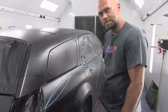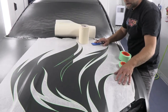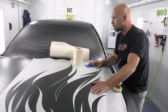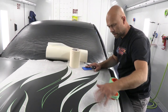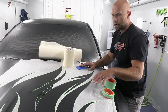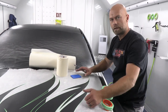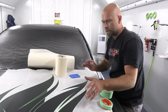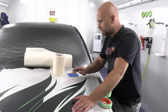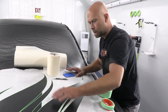Welcome back — we'll give you a quick clip on what I'm doing here. When we last left off I was laying out the side of the car, getting some artwork done for that two-tone split. We opted for an off-center asymmetrical graphic on the hood as well — so it's not going to be mirror image. Something real simple, kind of tribal, flamey, just to break up the monotony of the plain hood. I want to talk about a couple of different masking products and the technique. I did this with eighth-inch fine line tape and just let it rip in terms of how the layout was going to be.